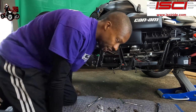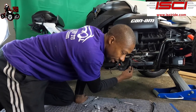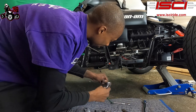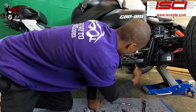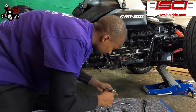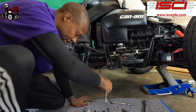So what you're gonna do is tighten your 8mm by 40 millimeters, the one going from the outside in for your forward slave cylinder bracket that goes into your master cylinder. You're gonna tighten those down finger tight, right? We can't finger them, so we're just gonna go with this a little bit. We're not gonna tighten them, we're just gonna get it until it's not moving anymore. Before, you would have gone out a quarter inch, so just so it's not moving no more, that's snug. Because there is Loctite inside, we couldn't do that. So we're gonna snug those up a little bit.